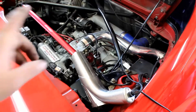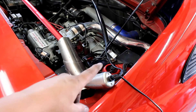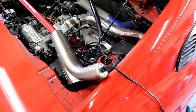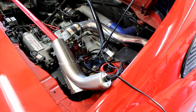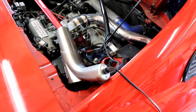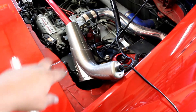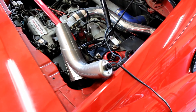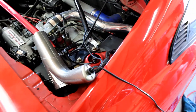That's really all there is to it. I tighten the bolts back up, double-checked it again — it's still on the 10-degree mark. I'm going to let it run like this for a minute, make sure the thermostat on the dash is at normal hot running temperature, then check it one more time. Then I'll shut the car off, pull the jumper, close that diagnostic port, and that should be about it. We need to replace this panel too, but obviously I want to double-check it first.